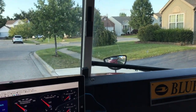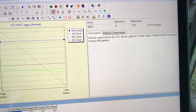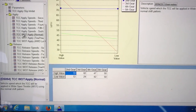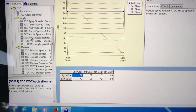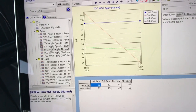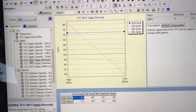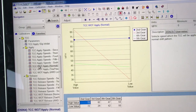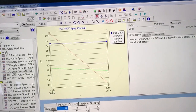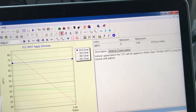So what we have to do is retune the torque converter behavior when it's floored, and see what it does in fourth gear. I thought that below certain speeds I'd be lugging the engine with the torque converter clutch applied — say below 40 or 50 miles an hour — and I'd be out of the power band. But it was the opposite: I could feel the torque converter clutch disengage and I felt like I had less power until it re-engaged a few miles an hour later. So we're going to tell it that under wide open throttle, the torque converter clutch needs to stay applied pretty much all the time.